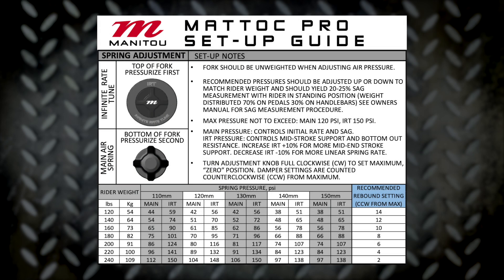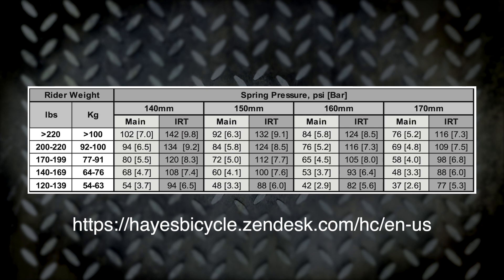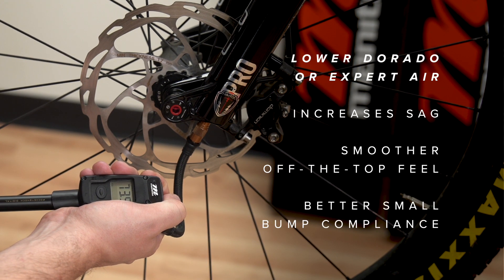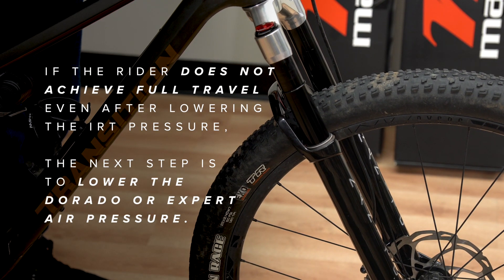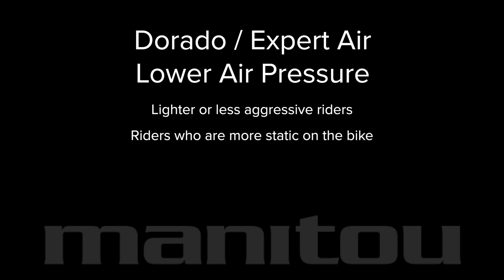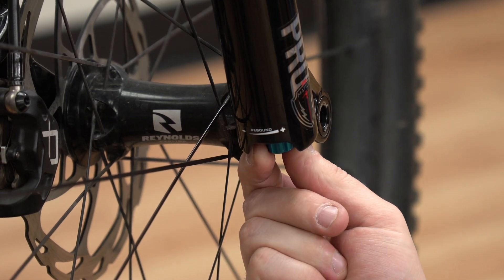Recommended starting pressures for the rider's weight can be found in the fork's setup guide. Precise adjustment of 1 to 2 psi can make a difference in the ride quality; changes of 5 psi will make a drastic difference. Decreasing the Dorado or expert air pressure will increase sag, giving the fork a smoother off-the-top feel with better small bump compliance. If the rider is not achieving full travel even after lowering the IRT pressure, the next step is to lower the Dorado or expert air pressure. Lower Dorado or expert air pressure is suitable for lighter or less aggressive riders, riders who are more static on the bike and prefer to let the bike do the work, and wet or very dry conditions where extra traction is needed. Lower Dorado or expert air pressure may require speeding up the fork's rebound.